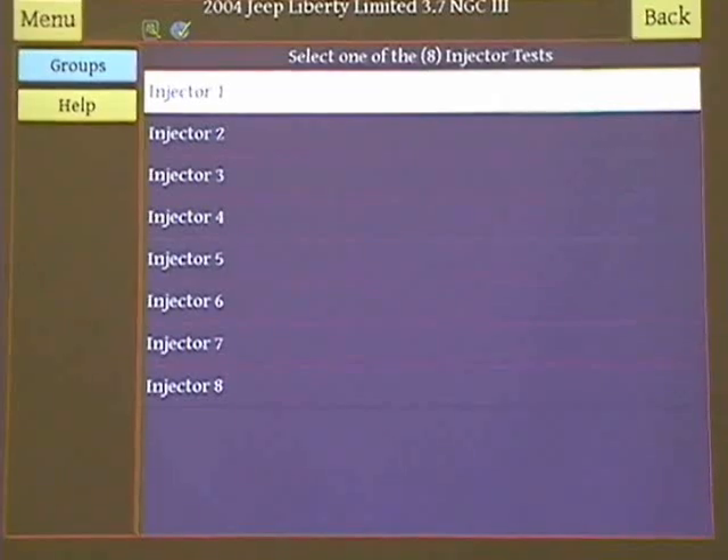You can hydrostatically lock a motor — you don't want to be pumping those cylinders full of fuel. If you're going to do them, make sure it works. A good idea is to move the injectors out. Never put your hands in front of a fuel injector because they're under high pressure — it can hypo-spray fuel into your skin. Make sure there's no spark around. Put them in little tubes or jars so you can see how much fuel is spraying, and this way you can check them.